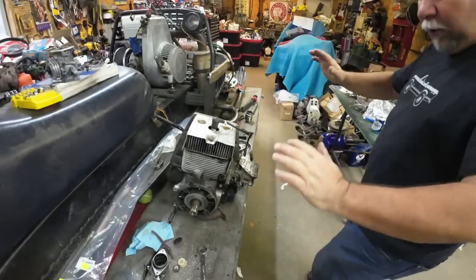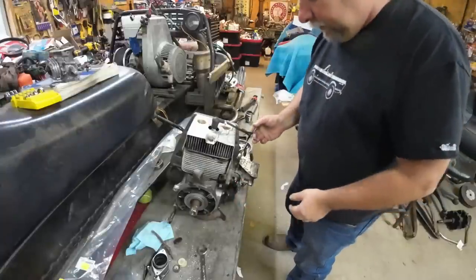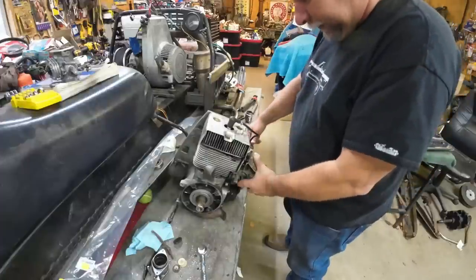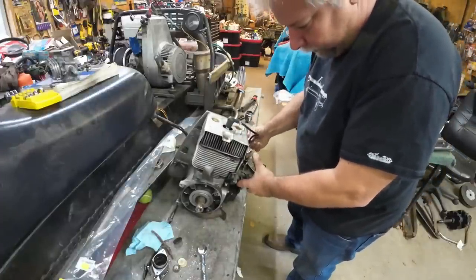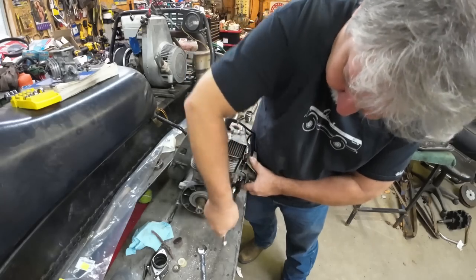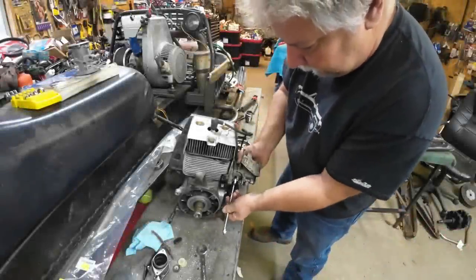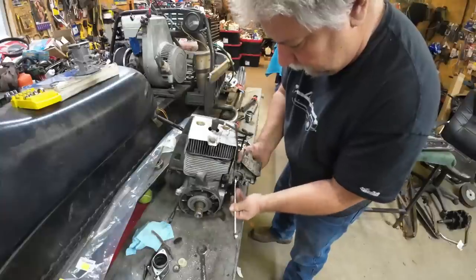What's this nutter? Why is the motor out? It's the old motor. Calm down. The first thing I need is these low boy nuts, and I need those to mount the carb. They're kind of special nuts, being that they're low boys like that. So I'm going to get this HR loose from here. At least I think. Might need a special wrench, which I probably have somewhere. But we're going to get this thing loose, and then that'll give me some access to get those nuts off. That definitely has some blue Loctite or something going on there, unless it's a crimp nut.